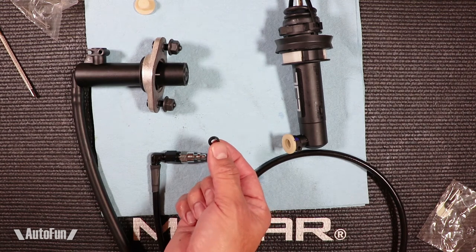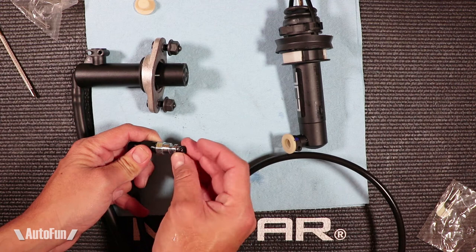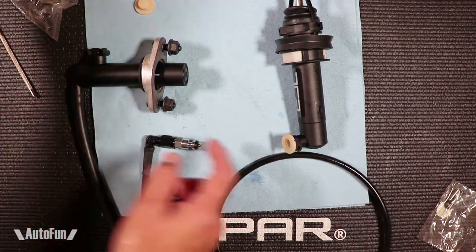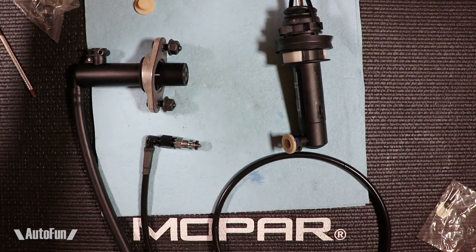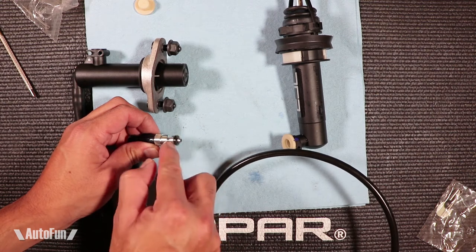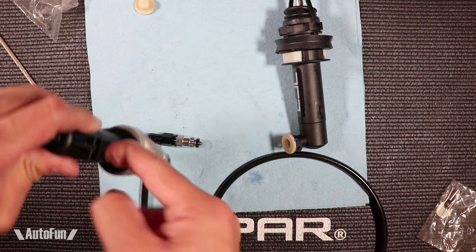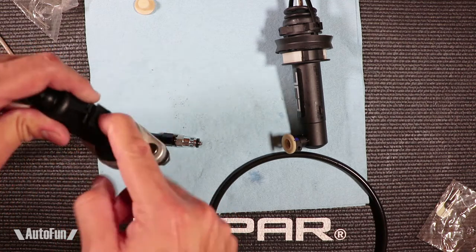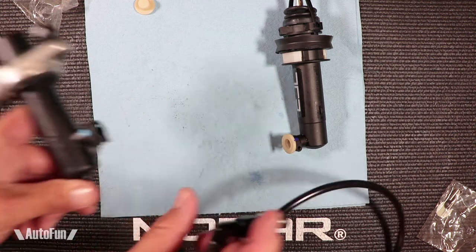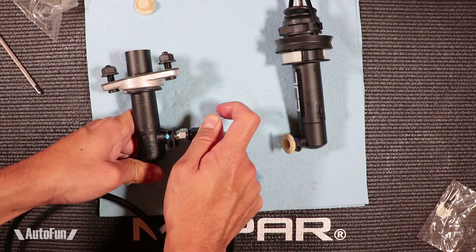Here's the rubber gasket. I found that the rubber gasket is probably better if it's inserted onto the fitting before I put it inside the orifice. Once it's inserted, I take a little bit of DOT 3 brake fluid to lubricate the gasket and lubricate the inside of the orifice. I already got it in there — a little bit of lube in there. Once that's fully lubed, we can insert this fitting into place.